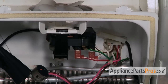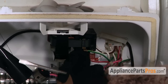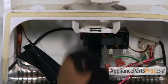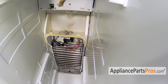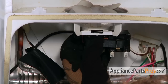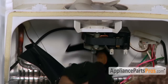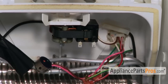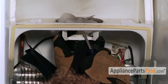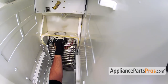To change out the evaporator fan motor, we have to first take off the three wires. Red's on the inside, white's on the outside, and then you have the ground wire. If it's on there tight and you have to use a small screwdriver to pry it off, go ahead. This motor is not held in by anything — it's just a bracket, so we can squeeze right here and let it release. Same on the other side and the bracket comes out. Once we have the bracket off, you can take your small screwdriver and pop the fan blade off. Then the motor should just pull right out of the mounting bracket.